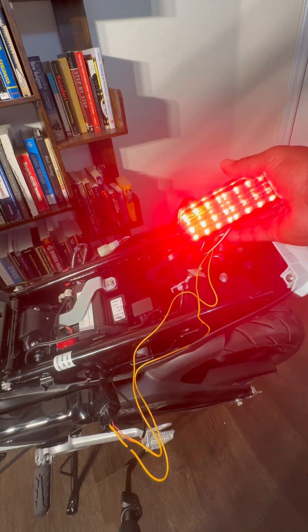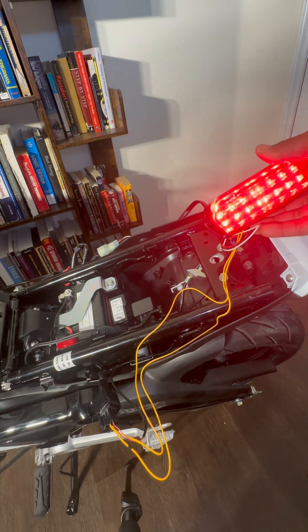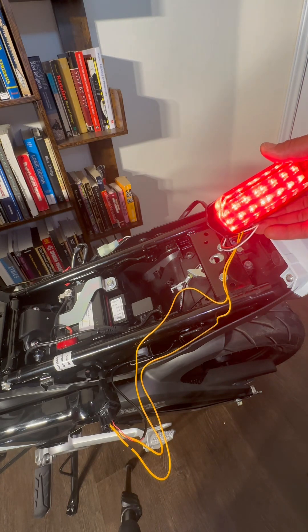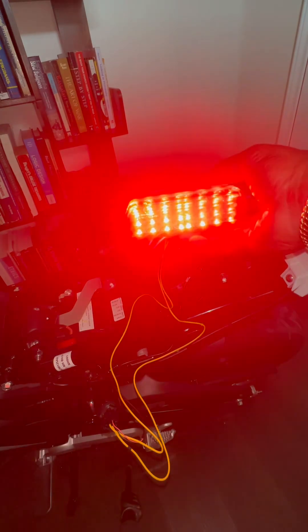It blinks left now. Remember when you're connecting these wires, you need to connect them to the right terminals of the male adapter for the flasher. One wire has a black strip on it and the other doesn't — they're both yellow, but the one with the black strip is going to go right next to the black wire.